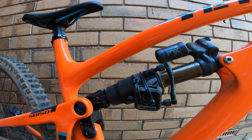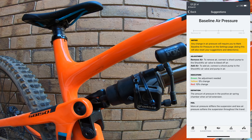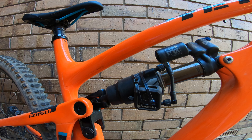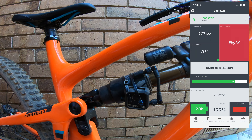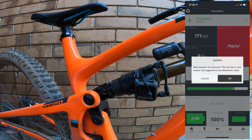So I'm now home and I'm going to go top to bottom of the changes that the ShockWiz suggests. Number one, it suggests adding some baseline air pressure — it's spaced in the yellow region, so that's a 5% change. My baseline pressure is 163 psi, so 5% of that is an additional 8, bringing it up to 171 psi. Attaching the shock pump, we'll bring that pressure up. With the new pressure reading at 171 psi, we just need to readjust the baseline air pressure by clicking the shock travel — which is 9%. Remember, if it's negative 3 to positive 3, and higher than that, you need to do this as well. Click that button, confirm, and there we go — all ready to go.